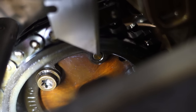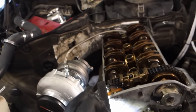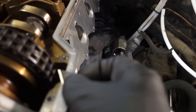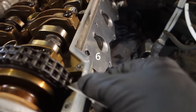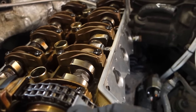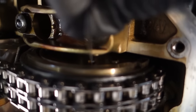Not the far pin, but this one here. The exhaust camshaft timing is correct. Now check the intake camshaft — same thing: flat on the surface, and count six teeth: one, two, three, four, five, six. Six teeth must align with this hole.